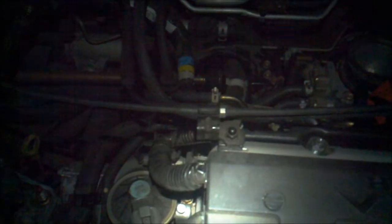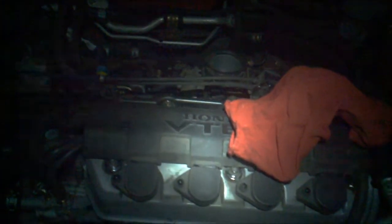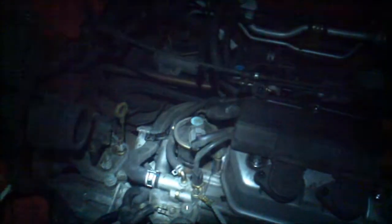I've run the throttle cables. See, there comes one. I believe that right there would be the cruise control. It comes off. There's the normal throttle cable. Go to there, wrap around down there, and then they all kind of do their thing over there. So anyway, I really think the only thing left is to put an oil filter on, put the intake filter housing and the resonator on, and then it's a matter of just some coolant and some oil.